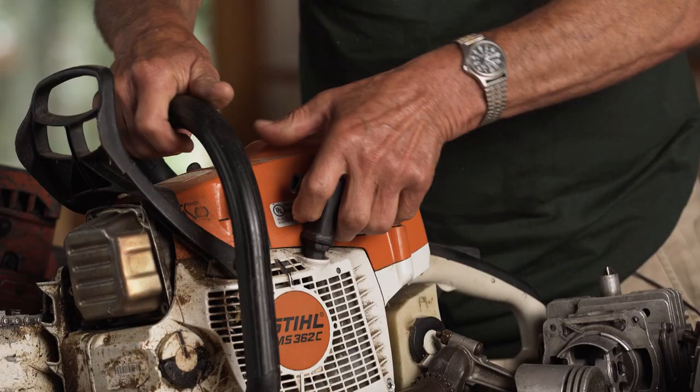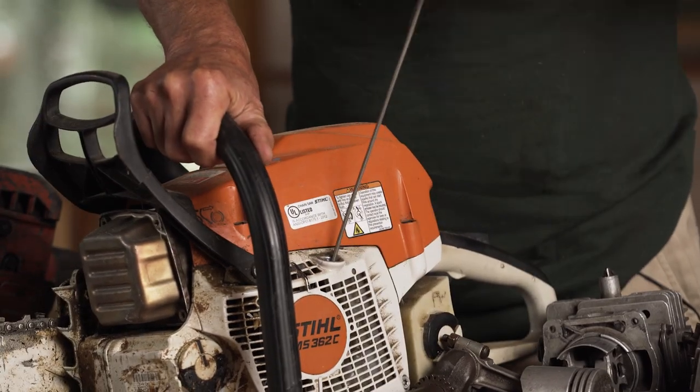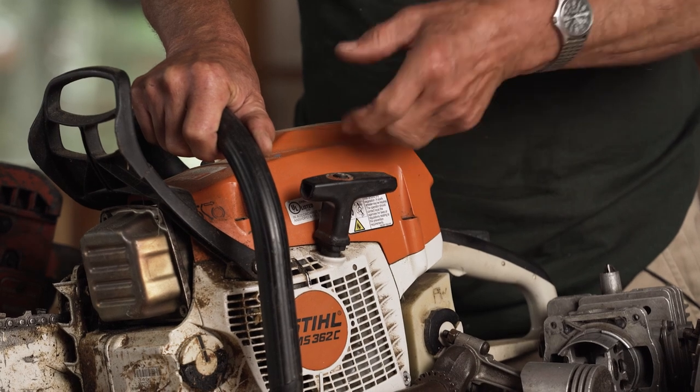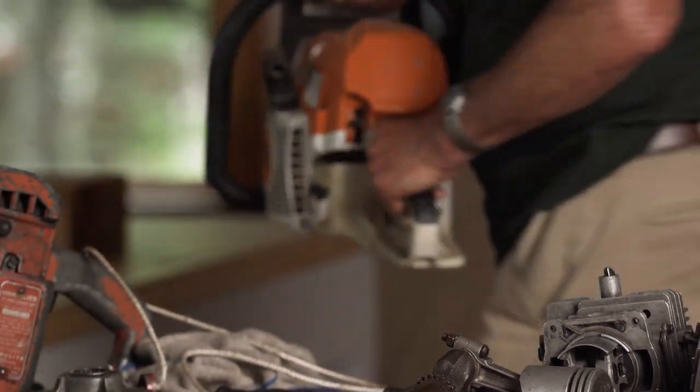The other thing I see people doing is yanking the cord hard. The centrifugal force of that turning sends some teeth into a drum to turn the motor. If you yank it, they gouge in, or the pawls that hold the teeth get bent and you ruin the starter. You should always pull gently until you feel it engage, and then pull the rest of the way. That will save the starter.